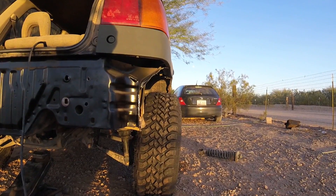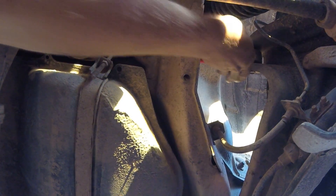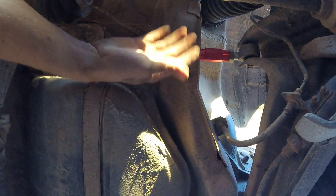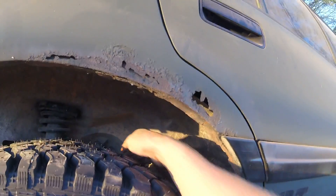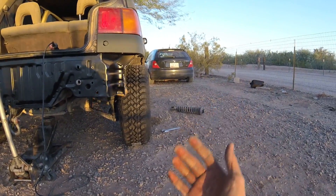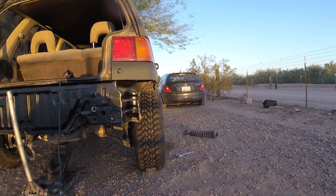Positive camber for the win - must have put another half inch of lift on it with all that positive camber. But the good thing is I can just crawl underneath the car without jacking it up and adjust the camber kit with my hand. How many other Honda Civics can you just slide right underneath and adjust the camber? I got out, looked at it, still needs a little more adjustment. It's pretty close - I could use one of those phone apps for hanging pictures to check the angle, but that'll be another day. This is close enough for me.